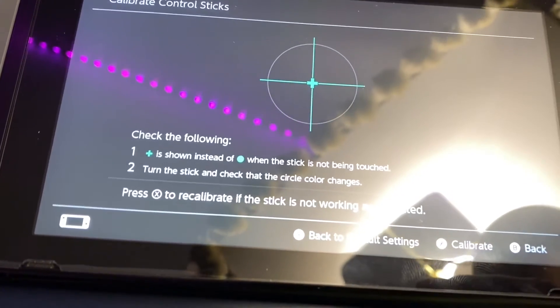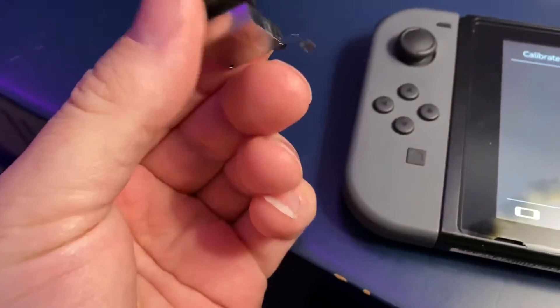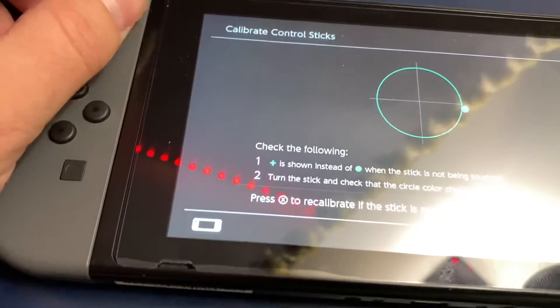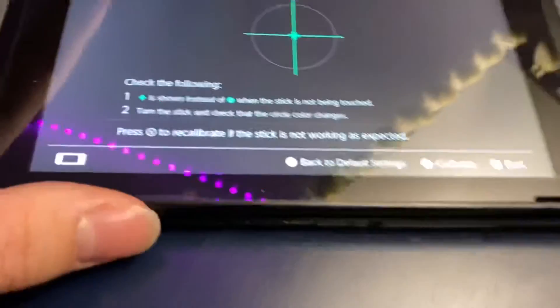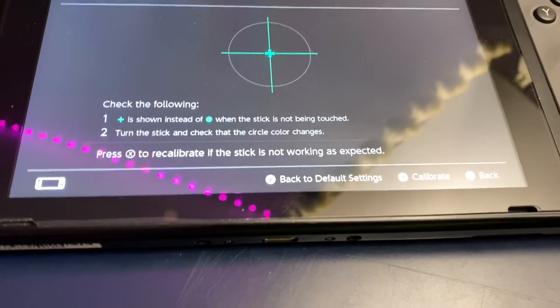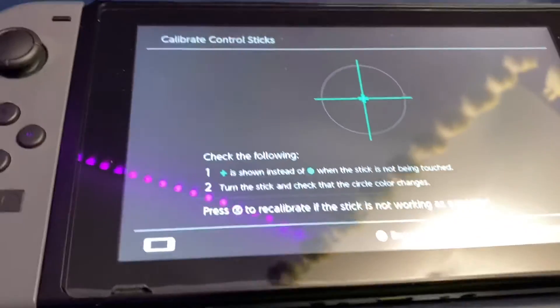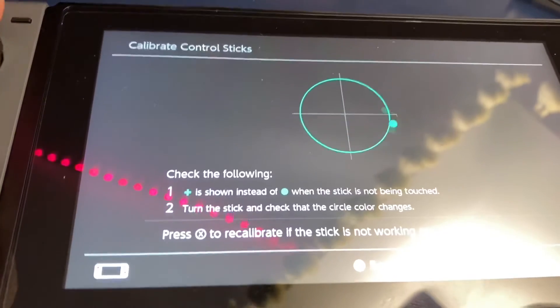Here's part four — I'm back. As you can see, this is the old joystick that 20 Godzilla had in the Joy-Con before, and the new one is in there and it's all put back together. I just fixed his drifting problem. Something interesting: I had to calibrate it when I first put it in because it was drifting a little bit at the start, but other than that it's working. Hopefully 20 Godzilla, you're happy with this.